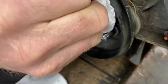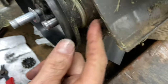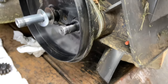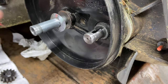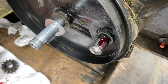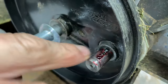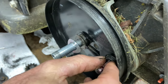I do have to make a video on this, but there is a problem with these machines — back here the axle comes through the frame. There is a bushing inside this frame that can get hung up and starts to dry out. There's really no way to grease it, but the problem you'll have is pulling these backwards — it actually won't work too well. Anyway, you can put a little bit of grease inside there just like we did on the last one. Put the spring inside the grease, then put a little bit more lube around there.